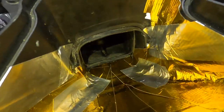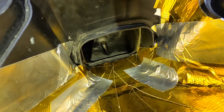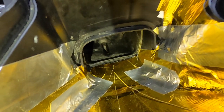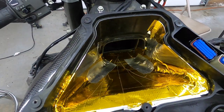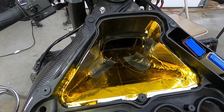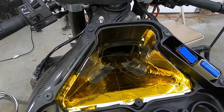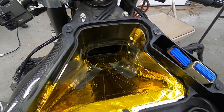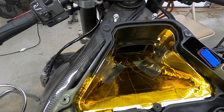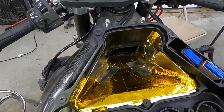If you look at where it connects to the frame, that is actually a much better seal and more solid than the soft foam. This is what it looks like — if you compare how much more airbox I have in the cleaner ramp versus the factory one, where it has to hit that wall then climb up and over, I'm really hoping for some good improvement.